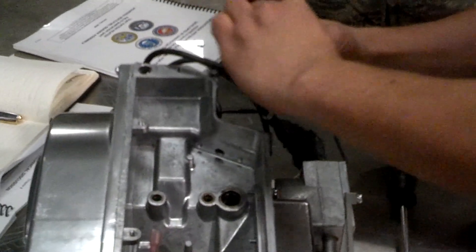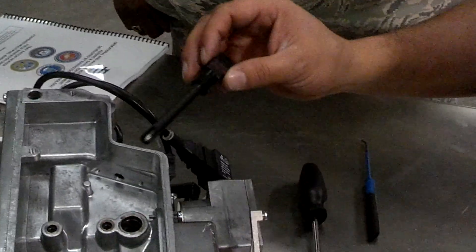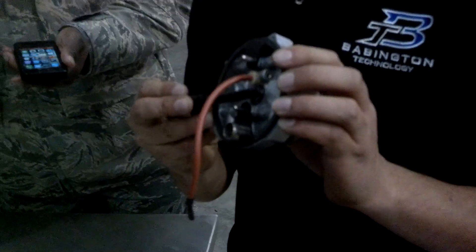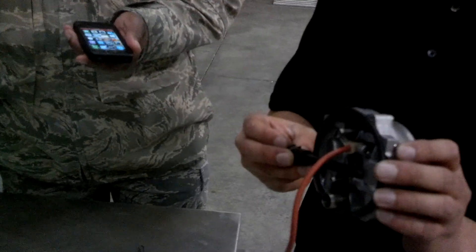Let me unplug this. You basically unplug it — it's got a little lock tab, you push down on it and unplug the photocell. What will happen if that spacer is not there is it won't stop at the right spot to be able to see darkness or the flame. It will actually go past it, and now it's seeing the back of the atomizing chamber — so it will see darkness and light, but it won't see the flame and stay lit.